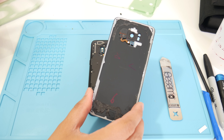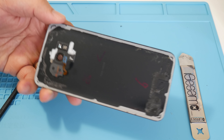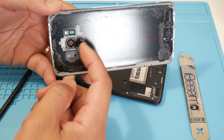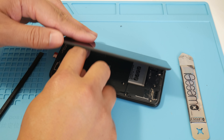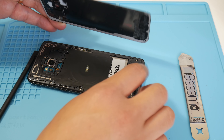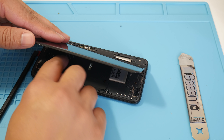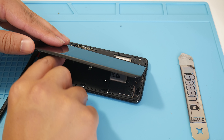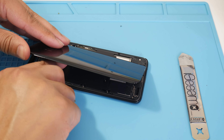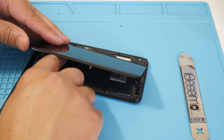After putting the new adhesive on the old glass back panel — nice and smooth — make sure the black side of the adhesive faces towards the battery door and the gray part goes towards the phone. Now for the home stretch: plug in the fingerprint sensor ribbon cable. There's a connection right in the middle at the bottom of the camera. You can use your finger or the spudger — using a finger makes it easier; you'll feel it click in.